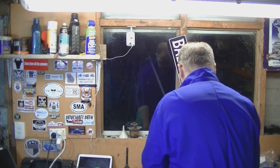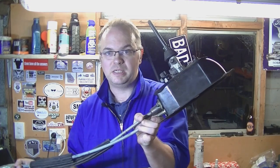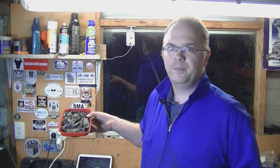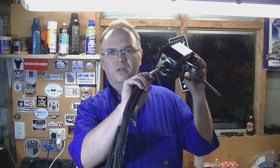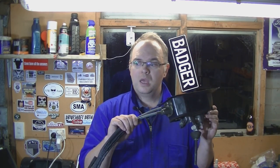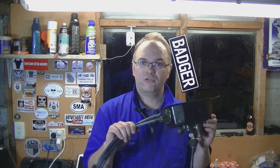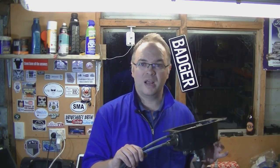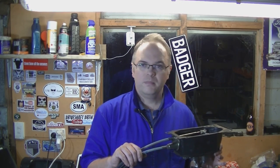So after the clutch pedal, we also need a shifter which is over here. As you've seen, I've already rebuilt it and just need to attach the cables. I bought it as a complete kit so there's a bit of a jigsaw puzzle trying to get it all together, and I'm missing a few nuts and bits. With the help of my big box of nuts and whatever else, I've managed to kind of find the right lots of nuts that fitted and locked them over. The cables are in. To put this on you have to go underneath the car, drop down the exhaust, reach up, take out the automatic selector, and put the new one in — I can't film that, but I'll try and give you a before and after.